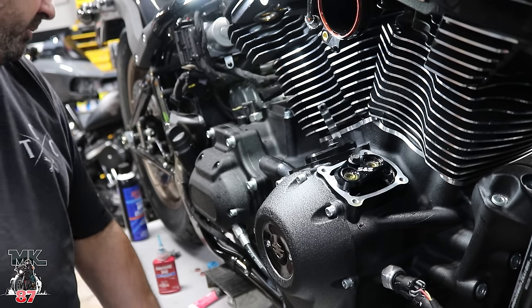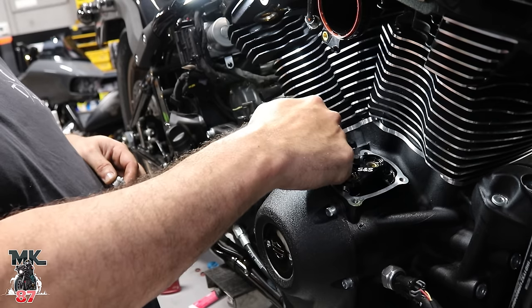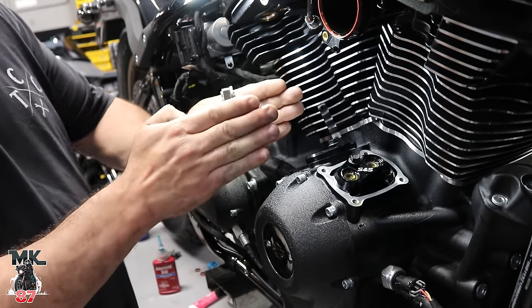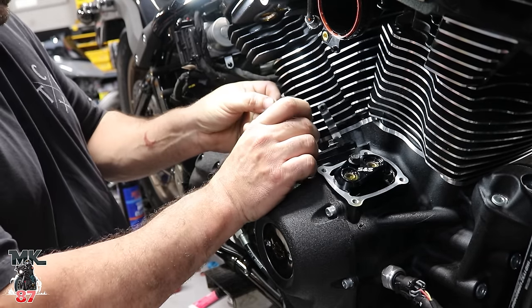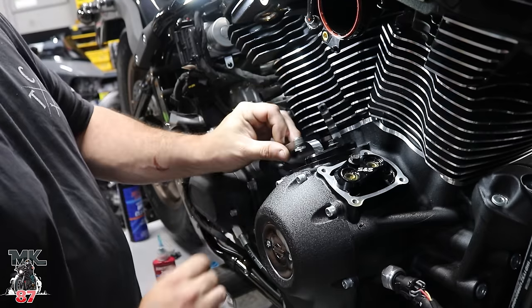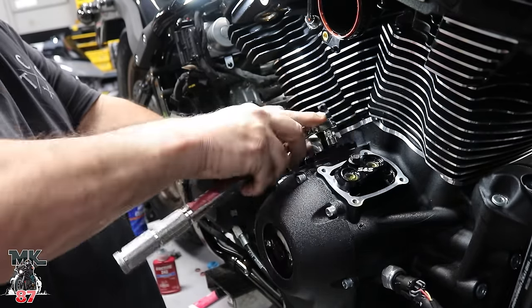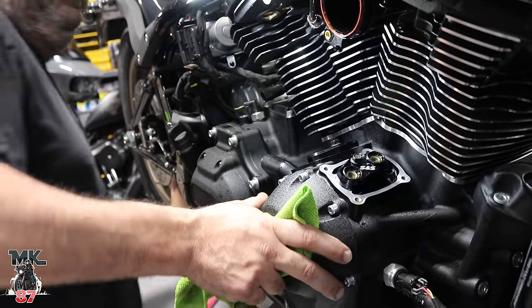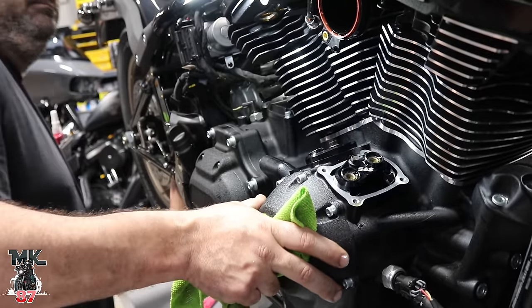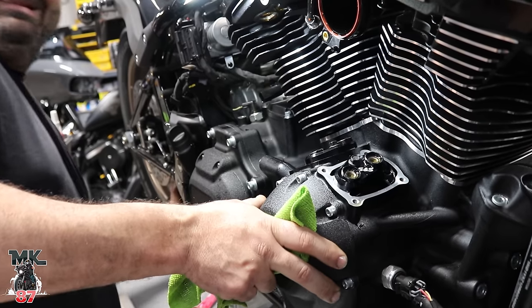When you tighten this, the cuff's gonna wanna go that way, so you space it here and here. Gotcha, okay. On the thrust side. Stick a 2/1000 feeler gauge in there and there, and then torque this. Now we're gonna check, make sure the rise and fall. Yeah, that's fine.